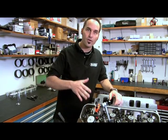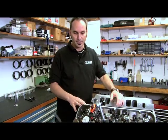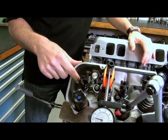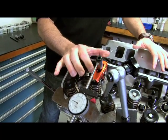Movement of that valve is almost instantaneous at high speeds — you're going to get high forces, big deflections. You can see this rocker arm stud, a nice 7/16th ARP mounted solidly into the cylinder head, but you've got an arm out here putting a lot of load on there, and you're going to get a lot of deflection.